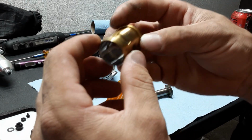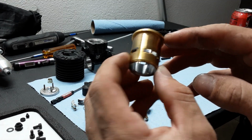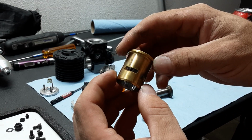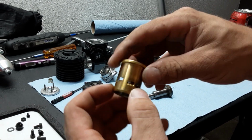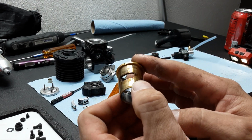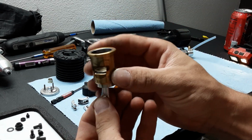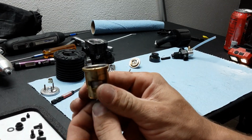And then let's look at our sleeve, right? So our sleeve, what is this? This is a 4-port engine, right? You got your 2 intakes, angled upward, massive side ports. It looks like a 3-port really, but it's a 4-port, I guess, with this double intake here. Tall, huge exhaust port. Man, that's big. And then to show pinch. Yeah, right there.